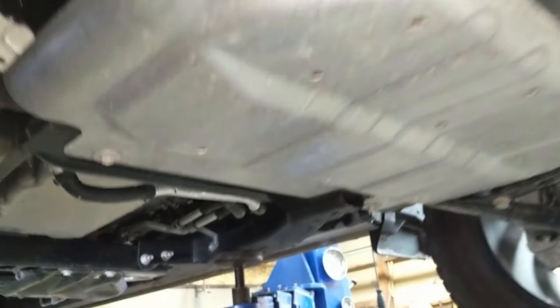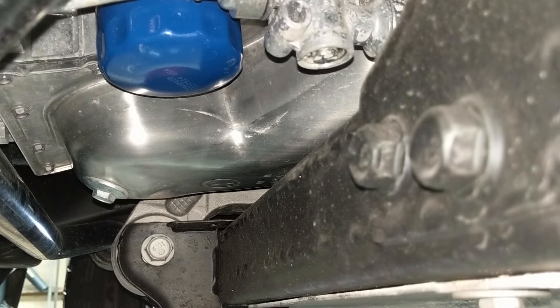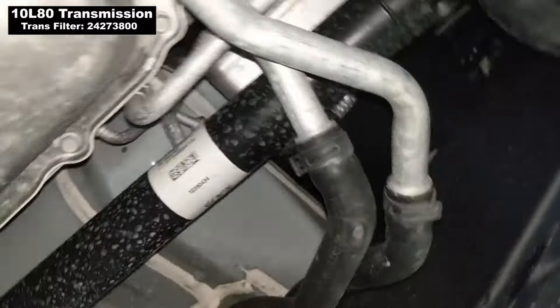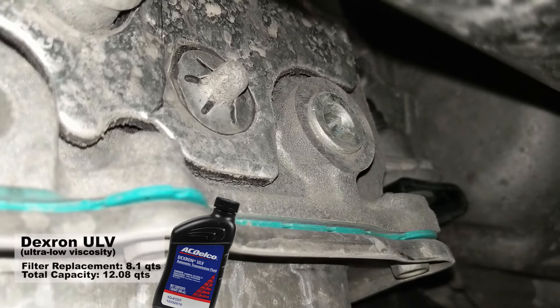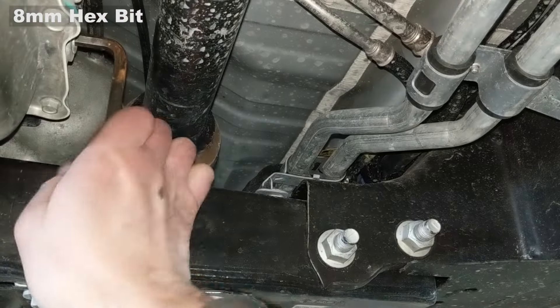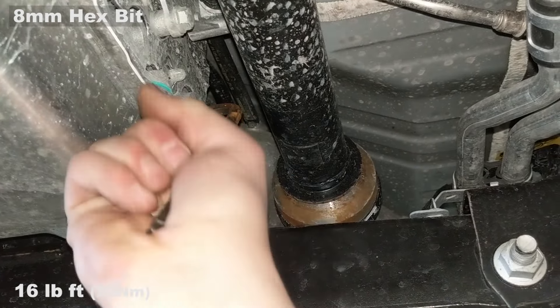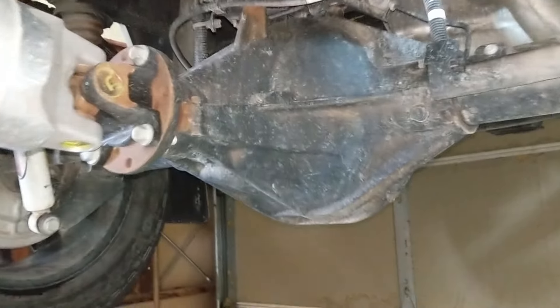Looking underneath, the oil filter and drain plug are easy to get at. It doesn't drain onto anything — the crossmember is out of the way. The pan is aluminum but has a steel insert for the drain plug. This 10L80 10-speed transmission is really long, but I like how all the bolts are accessible to access the transmission filter without any crossmembers or exhaust in the way. You check and fill it there — it takes Dexron ultra low viscosity fluid, accessed with an 8-millimeter hex bit. I'd probably use a bucket pump to pump fluid in. The transfer case takes the same 8-millimeter hex tool and uses 1.6 quarts of Dex-6.